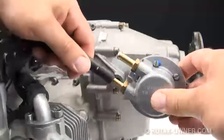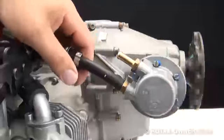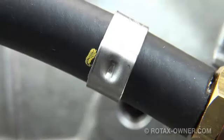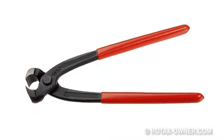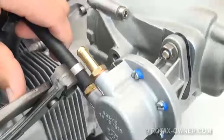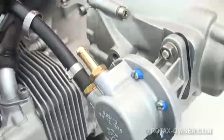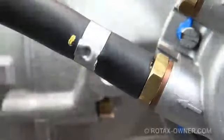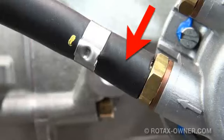Push the pressure fuel line onto the lower nipple fitting until it butts up flush with the base of the nipple fitting at the pump. Slide the first smaller clamp over the fitting, just behind the mark that we made on the hose. To crimp these Oetiker style crimp clamps, you'll need an appropriate Oetiker or Sirlock style crimping tool. These tools are readily available from many suppliers, including North American locations such as Home Depot and even Staples. Using the crimping tool, crimp the clamp securely in place. Crimping the clamp right behind our mark places the clamp at the optimal location for proper sealing on the nipple fitting. This also leaves us enough room to clamp the fire sleeve in place.